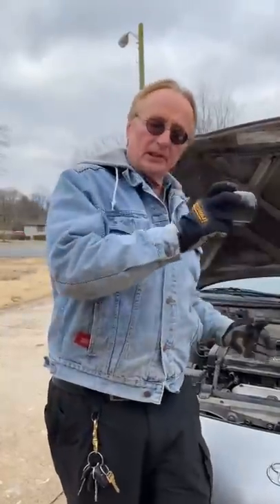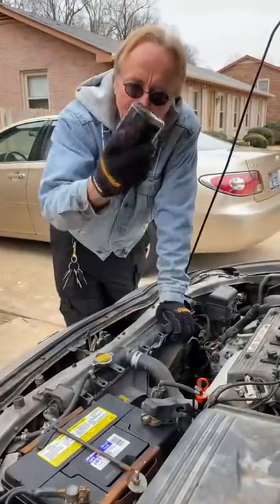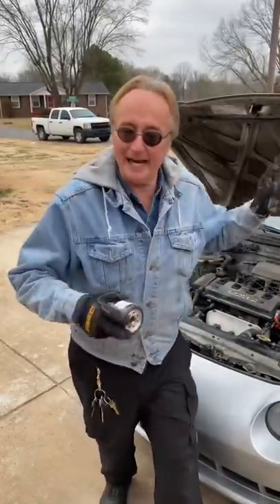With two gaskets, that generally leaks. I've had customers do it on their own cars and blow the engine. Two heads may be better than one, but two gaskets are not — with two gaskets you don't double your pleasure, you double your pain when the engine blows up.